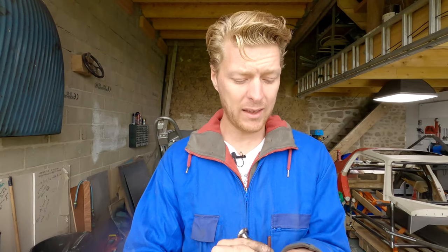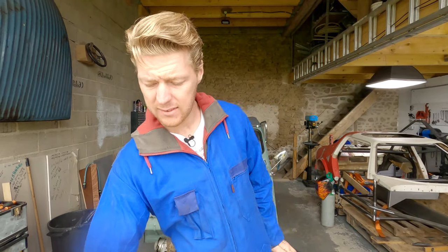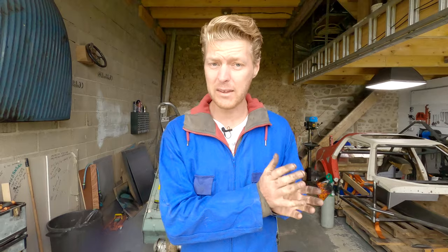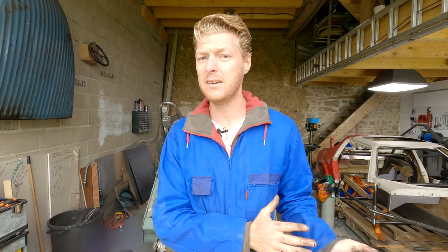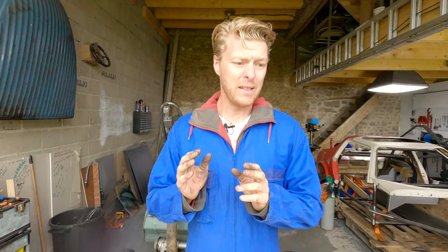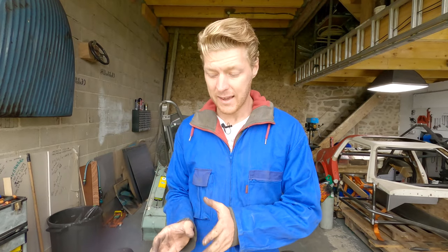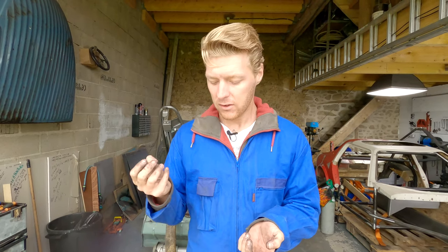And this is an engine that has 7-to-1 compression, which is less than any 2CV6 or anything. A 2CV6, I think, has 9-to-1 compression or 8.5-to-1 compression. So 7-to-1 compression is very little. There's nothing that's been made in the last 40 years that has that little compression, except for maybe a Series 3 Land Rover. So there's not a lot of heat comparatively to most engines going on in this engine, and yet it's got that hot that it's turned a really high quality valve dark. That just gets across how much damage carbon can do and how much it can upset the running of your engine. You can imagine that exhaust valve glowing at 5,000 rpm.